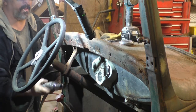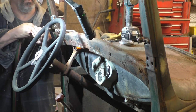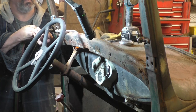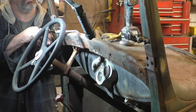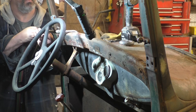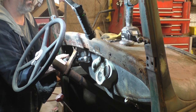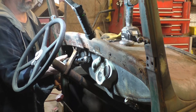Like that one came out. These cage nuts are thin. I'm gonna melt them if I ain't careful. I'm just trying to get a little bit of warmth on the bolt, best I can. If this don't work, I have to try to heat it from the bottom. Heat the bolt head, which I could certainly do. That one broke loose.